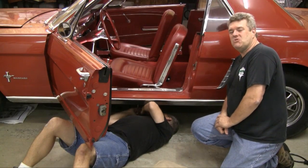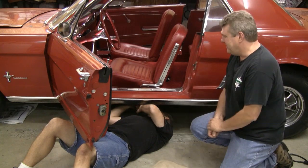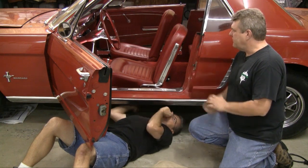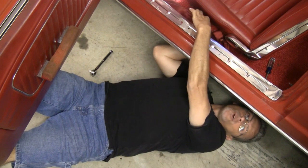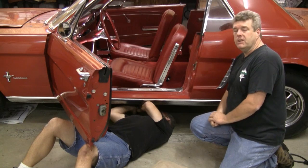Now I've got Larry underneath the car. Why the Pontiac guy is working on the Ford, I don't know — he didn't even know where the seat bolts were. We're also going to have to remove the sill plate, the kick panel, and the instrument cluster to make this all happen. We'll get to that after we get the seat out, because Larry and I are too old to do this with the seat in the car. If you're not going to take the seat out, you would need a shorty screwdriver to get a couple of those sill plate screws.